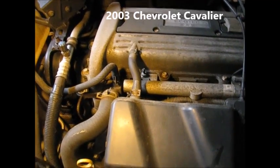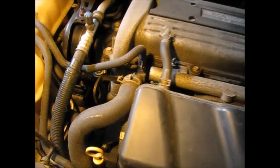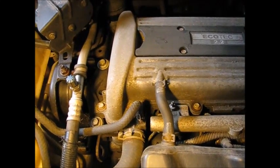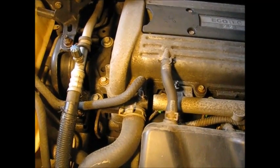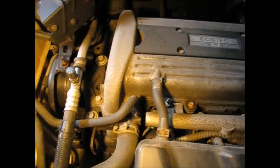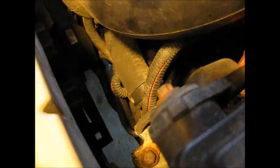So we've got this 2003 Chevy Cavalier and it won't start. It'll crank — it's turning, and it sounds like the starter's really rolling fast, almost like it's not loaded. We're going to pull this apart and have a look at the front end of the engine because it suspiciously sounds like maybe a timing chain issue. Let's disconnect the battery.